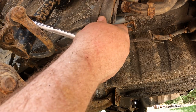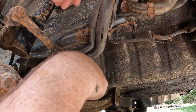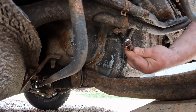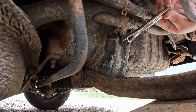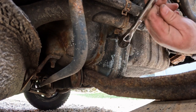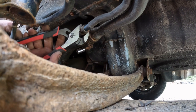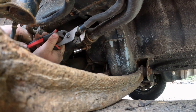It's starting to move now. I believe I'm disconnected up top. Before I pull that all totally free, I need to get to these over here. The large fuel fill has — it looks like a 10 mil, yep, a 10 millimeter. It looks a little corroded; I'm not sure if I'll have to replace this. Looks like we're able to move it. I finally got this smaller one free.